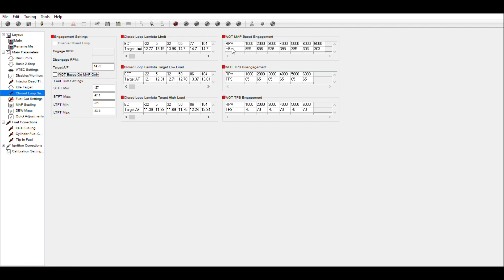These are the air fuel ratios — we'll get into this next time with the target air fuels. This is mostly for closed loop. Closed loop is what we consider running off of the computer, running off of the O2 sensors — it has its own calculated idea of what it's looking for as the target. Wide open throttle is what we consider open loop. That gives you a little bit of the difference between the two.